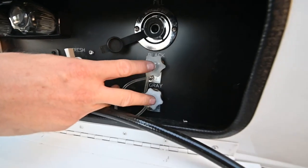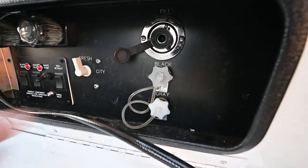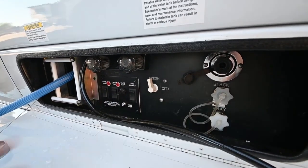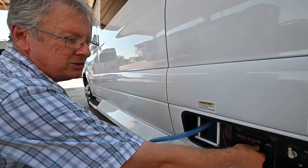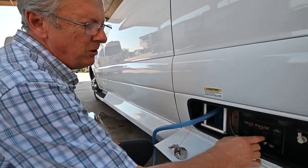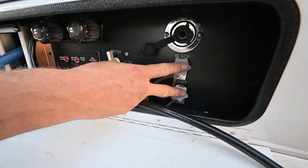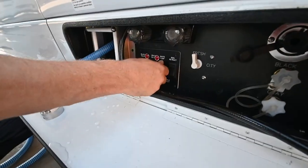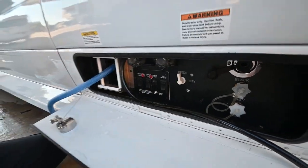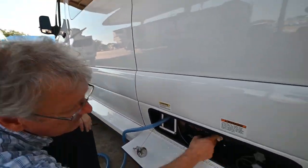You also have flush connections for both the gray and the black. Hook up a garden hose here - when you turn water on, always want one of the valves open that you're hooked up to. For the gray, you would open up the gray and flush that out for about 10 minutes, but also have the waste pump turned on because the water is going into the gray tank, spraying the sides down and cleaning it - and you need somewhere for that water to come out. Never walk away from this when you're doing the flush on the black or the gray. Always have your valve open and the macerator turned on, just like when you're dumping - otherwise you'll fill up your tank and it might come out the vents at the top or out of your toilet.